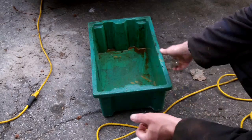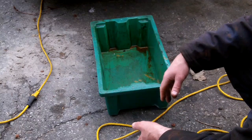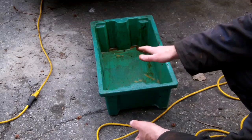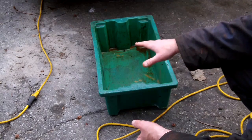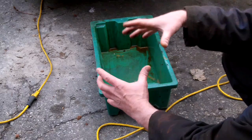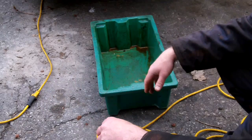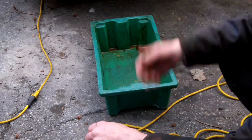If you're doing this, you're going to need a large container — about a 3 or 4 gallon container to catch the fluid. It doesn't have to be clean, it just has to be empty. Because once we drain the fluid out of the pan, we're going to measure how much comes out. I've got a 1-liter measuring cup — I'm just going to pour it in, measure it by liters, dump it into an old container, and then once I've measured all of it, I know how much to replace it with.